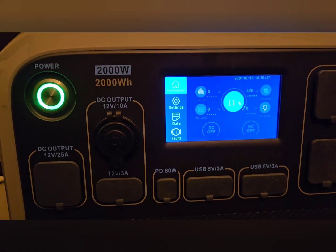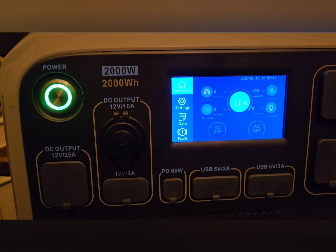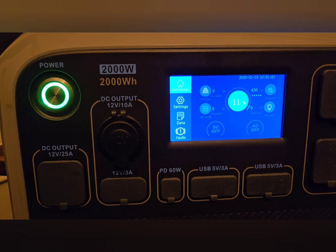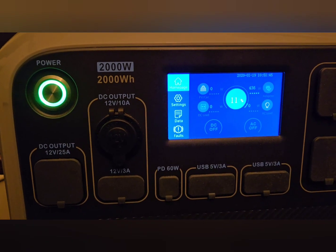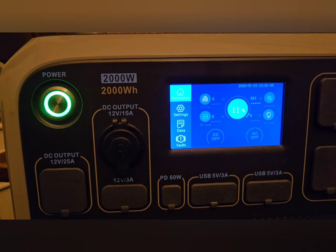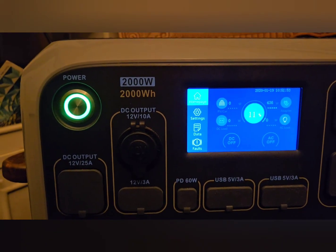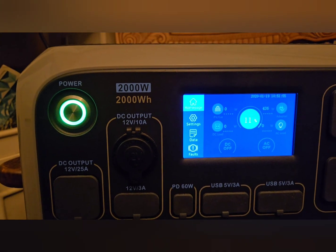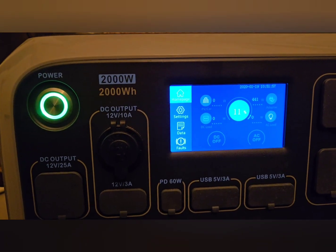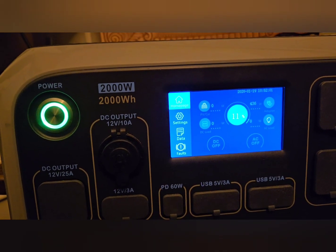It doesn't say back right now. It says home, but it will when it's beeping orange like that. You hit that twice, you clear out your faults, and then you move your hand away from the Bluetti. Do not touch the device. It will then eventually start to power up. You just gotta stop pressing all the buttons and trying to figure out, like you're MacGyver defusing a bomb, how you're gonna do this in under 30 seconds and get this thing to work.